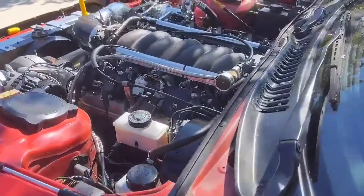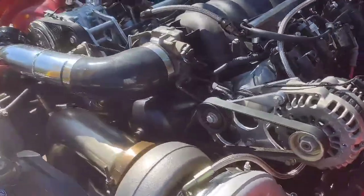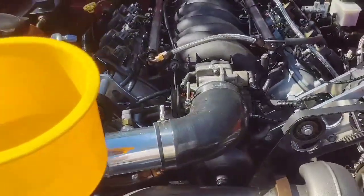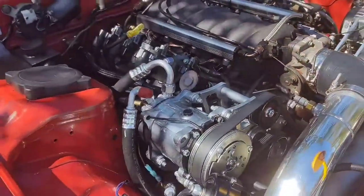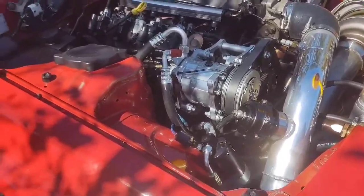So all of the coolant is going into the engine. I don't know if it's got a cracked sleeve or the head gasket isn't on there right or what. I'm not sure. I didn't have the heads off of this engine. I just put it in like I got it, because it had ARP head studs and everything, so I didn't want to mess with it.